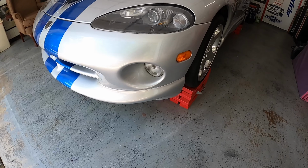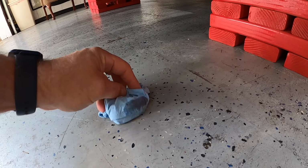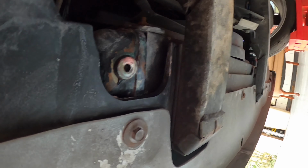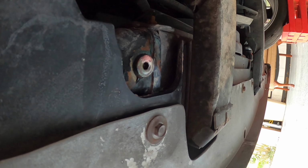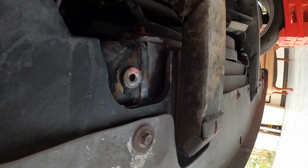See, I've got some radiator fluid leaking from the driver's side, and it's probably gonna be the radiator if I had to guess. I was thinking it was going to be this plug right here because see, there's moisture around it, and I sealed it, but it lessened, but it didn't quit. But look here at this radiator. That's pretty much going to be my problem.